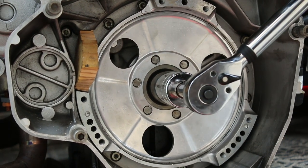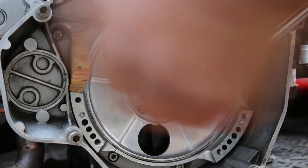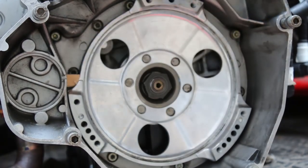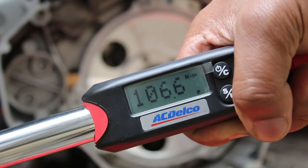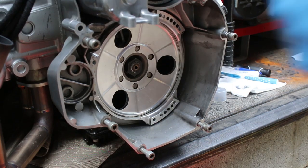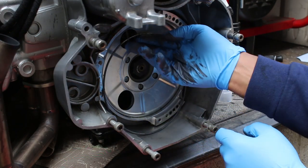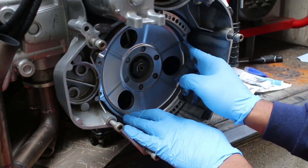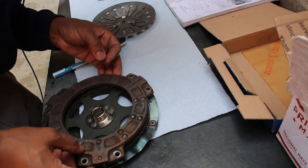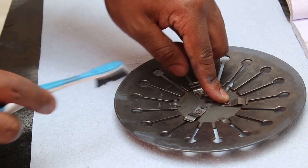Once it's fully loosened, reposition your wood for the tightening and tighten it back to the second stage of torque. You're supposed to do 95 Nm and then turn it 60 degrees more from there. Since I didn't have a torque angle meter, I just went to about 107 Nm and used a ton of blue Loctite gel over it. BMW says you should replace this nut and I am reusing it, but I do not recommend you do it — it's possible but I'm making no recommendations here, it's your discretion. Since the wood block kept breaking, I made sure to vacuum up all the pieces in the bell and behind the clutch carrier. There's a little ring that goes around the clutch carrier that rides on the spring plate — you're supposed to lube it with the same spline lube, but it's important not to overdo it with the grease.